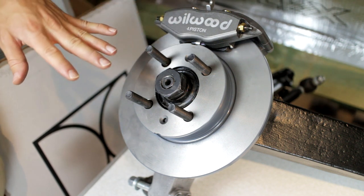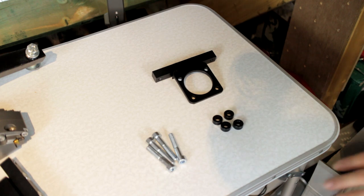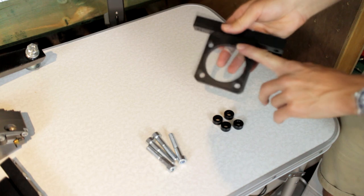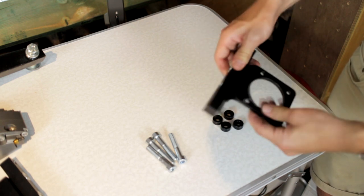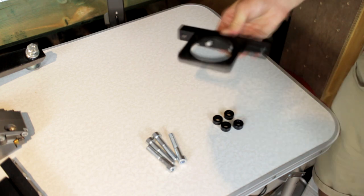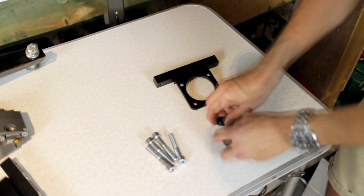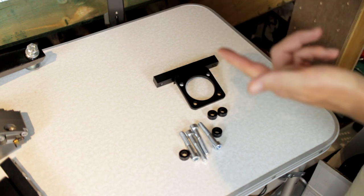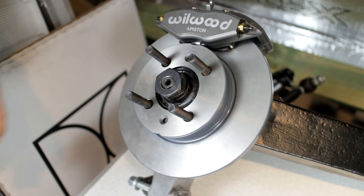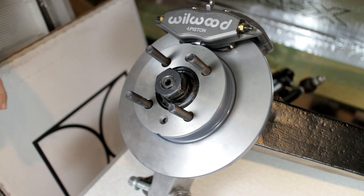I have written everything down about what every kit entails. Essentially if you want to buy one of these conversion kits, what you will get is two galvanized steel brackets with an aluminum mount already bolted and loctited, threaded and set up for your brake kit — either the 240 millimeter kit or the 260 millimeter kit — plus four spacers and four bolts. What you will need to source separately is the calipers, the parking brake cable if you want to use that system, and the brake discs. I hope you enjoyed this video — it's been quite fun making this and I can't wait for the car to be on the road. Don't forget to subscribe so you don't miss any of the upcoming videos and I hope to see you next time. Goodbye!